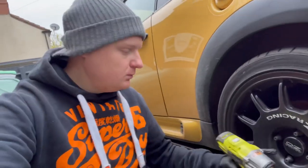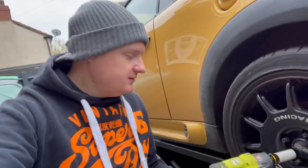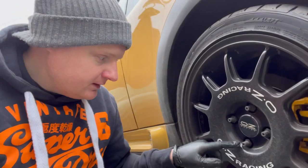A second tip: where you've got to take wheel nuts off, especially with nice aftermarket wheels or stock wheels you don't want to damage, you can buy one of these thin-walled sockets. On the outside it's PVC-lined, so when it goes into the wheel and rubs against your alloy, it's only rubbing away at the soft PVC rather than taking out your paint finish. I'd always recommend them for wheel bolts — they're just a cheap eBay or Amazon purchase and they avoid damaging your wheel finish.